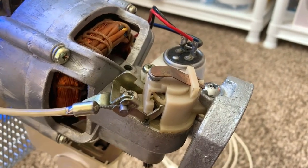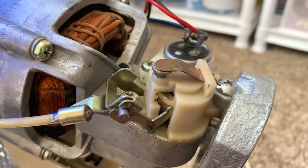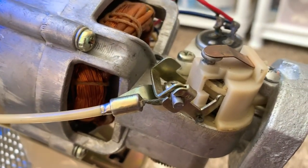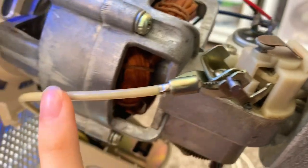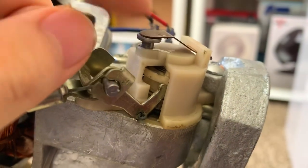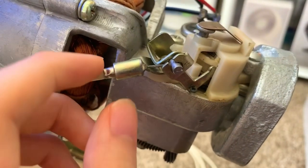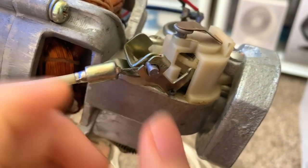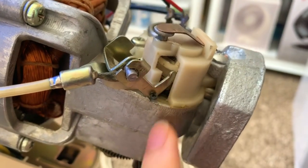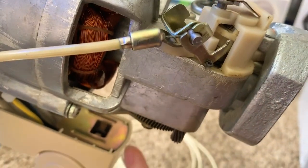And of course the coolest thing about this fan is the oscillating mechanism. What we have here is a spring-loaded wire cable system where this is the wire cable going to the knob at the base. Inside there is a spring that holds up this little gear, and when you turn the knob this cable gets released and it drops this gear, which locks the worm gear from the motor shaft to the drive gear.